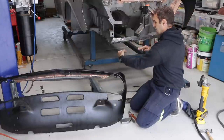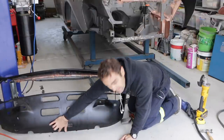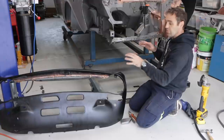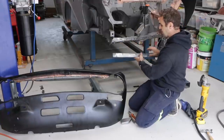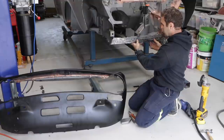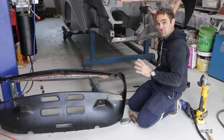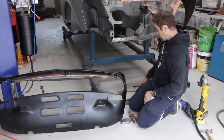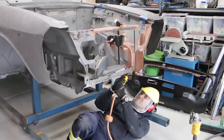Putting this in is important to get it in the right spot to match up with the lower lip of the front bar. Basically when this panel goes in there, I'm going to have to make up a sheet that comes down and across and spot welds along to this bottom edge here. The next part is getting the right height for this piece so that it all lines up and then the front bar can go on and be nice and square and straight and even. Let's start mounting this bit up.